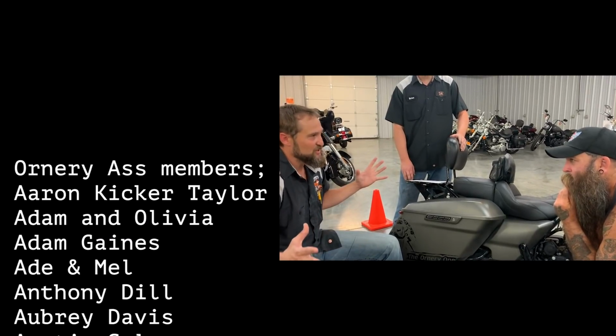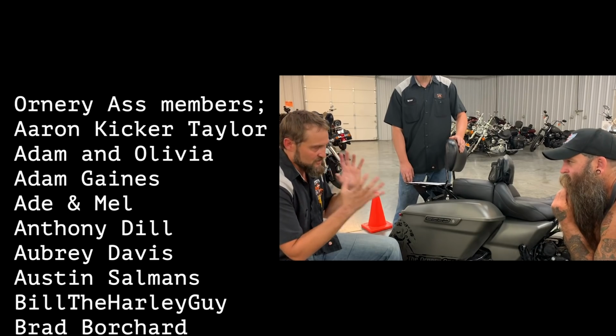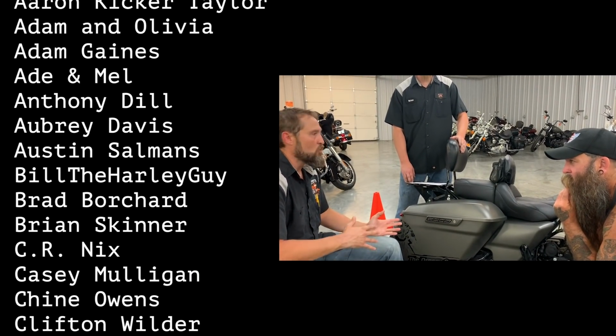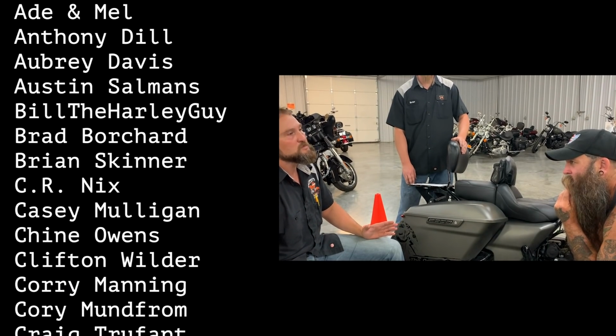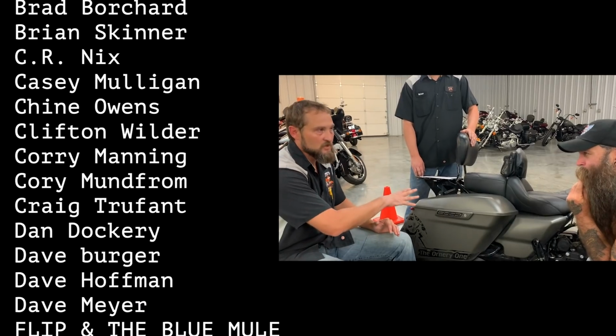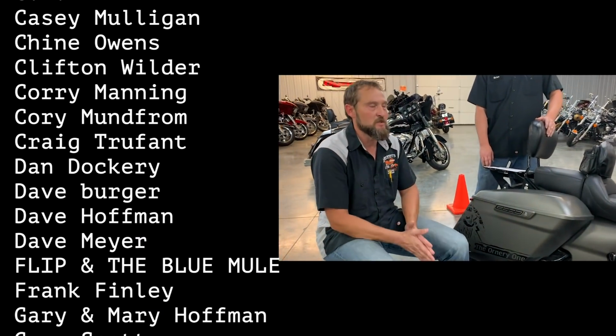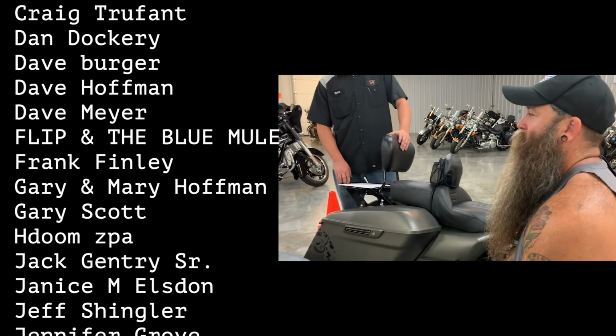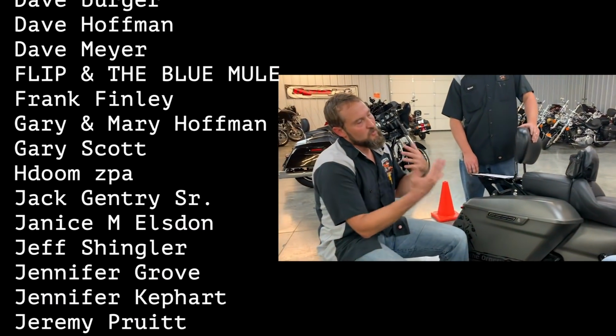We've put all the ingredients together. We've given you the bang for the buck that you're going to get out of a stage 2. Now, would a horsepower cam give you more horsepower? Yeah, it would probably give you more horsepower, but that doesn't really match you guys' riding style. Yeah, that's where you have to decide. That's one thing you have to decide on, torque or the high end. Well, and then the warranty thing again.